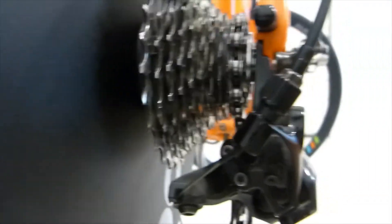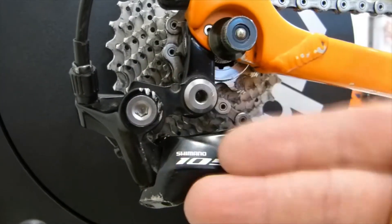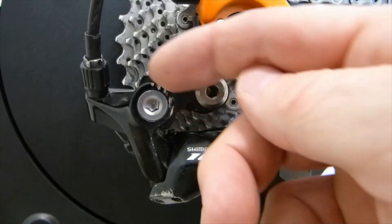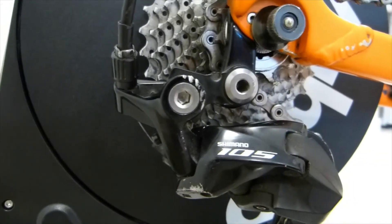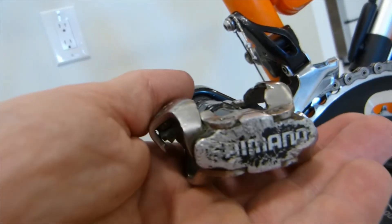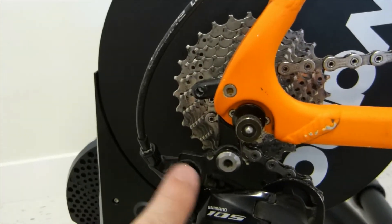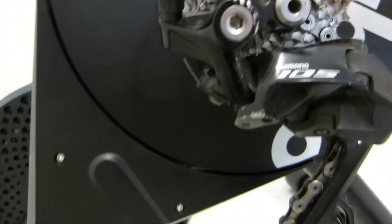The reason why this happens is because the bike fell on its right side, on the derailleur here. You can see evidence of this — some scratch marks here and here as well. It wasn't a massive wipeout. You can see scratch marks at the pedal, because the pedal touched the pavement, as well as the corner of the derailleur here. These scuff marks are not normal wear — they are a result of a fall. And as a result, the derailleur hanger got bent.